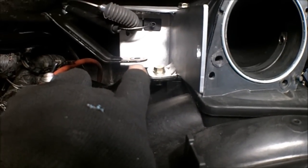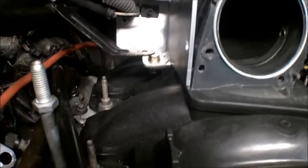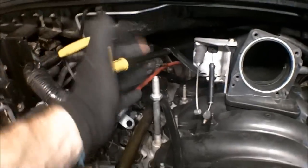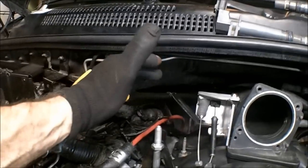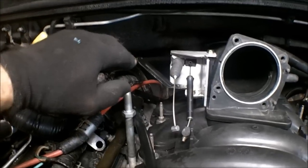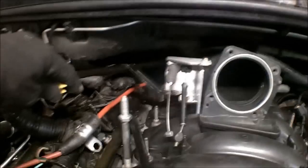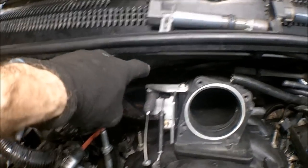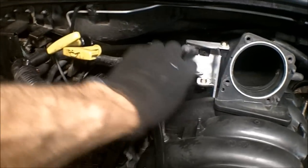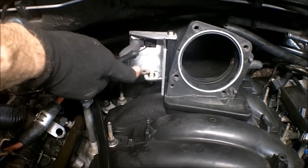I'm going to hook the dipstick tube bracket here up to there. Now, before it was quite a ways away from that. What I did is I was just grabbing the dipstick tube right here and just pushing on it, kind of pulsating it back, and it would just slowly, you're tweaking it back that way. You're not putting a kink in it or nothing, but you are putting a bend in that tube back there, just giving it more of an arc as it comes around. And you'll find that it will bolt right up to this bolt right there. Be a nice fit.